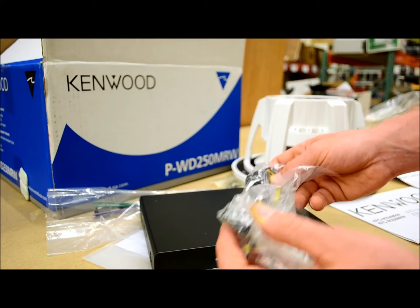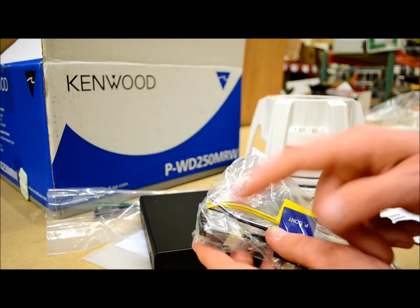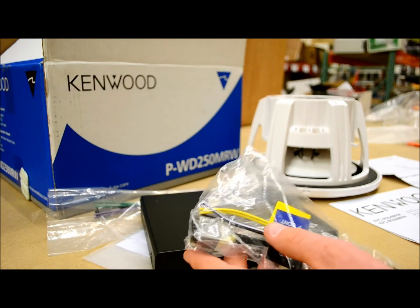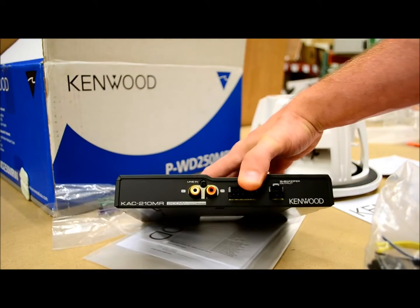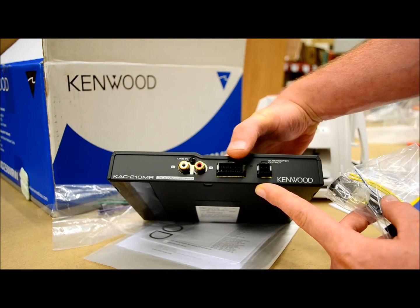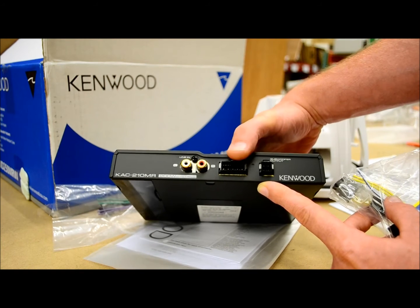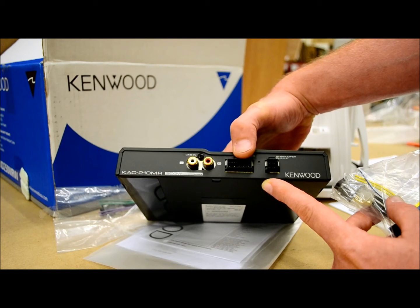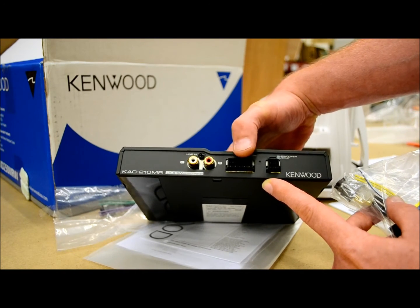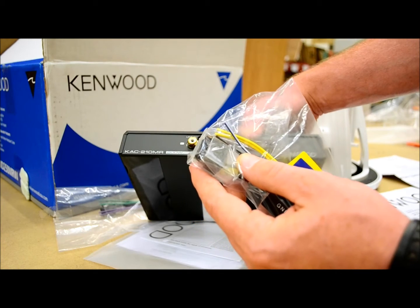Getting back to the 10-pin plug — I thought this was noteworthy. The instructions say this unit will take high and low level audio inputs. Here it's taking low level via the RCAs. In the plug, prior versions used to have an extra set of four wires for a high level input, so if your stereo lacked RCA output you could connect left plus/minus, right plus/minus along with power, ground, and remote turn-on lead and be done with it. That is oddly removed from this package.